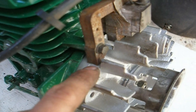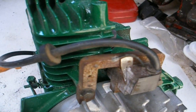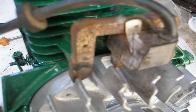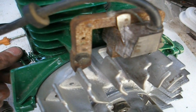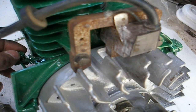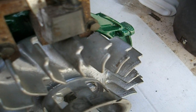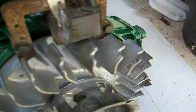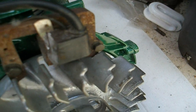So then what you'd normally do is loosen off these two screws, one either side, and stick a business card or similar — a business card is generally a good indication of the gap between your magneto and your flywheel magnet. So you stick your card in there, push it down hard against it, and then tighten up your screws nice and tight.